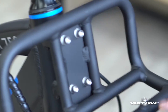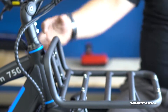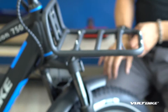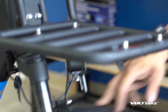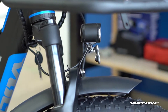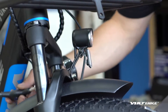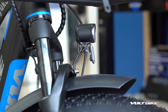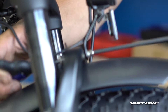Okay, there's the basics of the rack being installed. From here we're going to move on to cable management and the relocation of the light. First things first, we're going to remove the light from the fender bracket here. That takes a 5mm allen key in the bolt on the front and a 10mm wrench in the back. I'm going to hold the back nylock nut and then use the allen key to spin off that fastener.